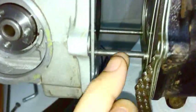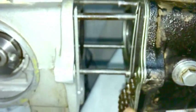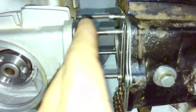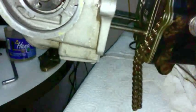If you have one that's starting to corrode like this, surface corrosion is okay, but what I like to do is flip the studs. Of course, if you buy new ones, you don't have to worry, but if you're on a budget, this is free, so why not? Pull the bottom one out that has a little corrosion, put it on top, and put the top one on the bottom. You can't flip it with the other side; you have to use it on the same side because these two are longer. That way you get the strongest stud on the bottom, and the one that sat outside all the time is now inside, which balances things out. It's just a small trick that I like to do. It helps. But yes, that little channel is where the stud is literally on the outside. I found that very interesting. I had no idea about that.